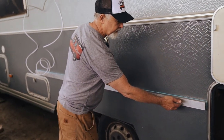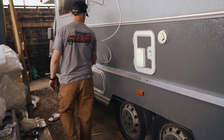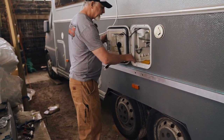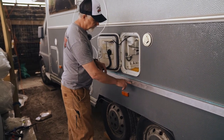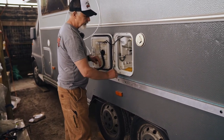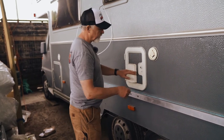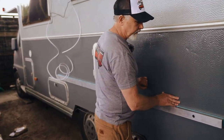We've done it. This bar is a 25mm by 50mm — one inch by two inch — aluminium rectangular tube. We've fastened it with 8mm thread bars going through here to the metal structure inside, and also over here. That already improved things. Then we mounted a block of wood inside where the gap was really big, put two veranda bolts in and pulled it quite tight. It's now completely snug against the floor — no more give. The bottom is beautifully stable now.